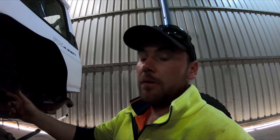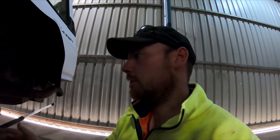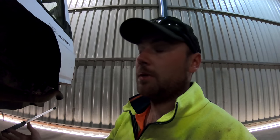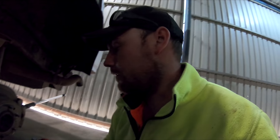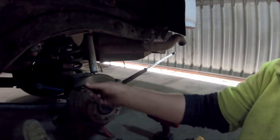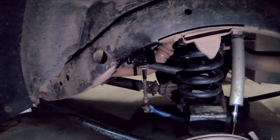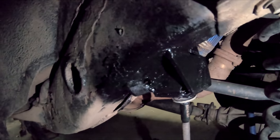Unfortunately that's just what happens - you've got to keep an eye on the mounts where they join to the chassis as well, because that can crack off too. It's pretty simple to fix, but you've just got to keep an eye on it - probably preventative would have been the thing to do. I've cut up these three bits of plate - one for underneath and then one either side - which will just run along underneath the chassis there, a bit more strength, and stop this happening again. Job done - that won't break off anytime soon.